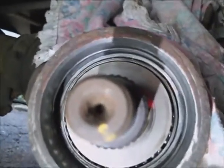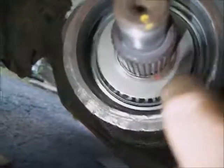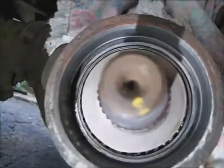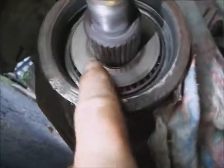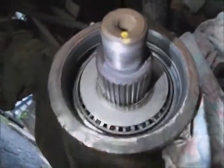Let the hole degreased and the sealant scraped off the inside and the bevel. I put brake cleaner on the rag and degreased this inside diameter so that the silicone on the seal can sit up and not let grease past it. Make sure there's no dirt on the splines. I've wiped this washer off, degreased the threads on this, and degreased the inside of that.